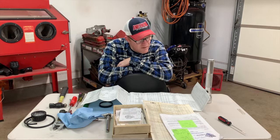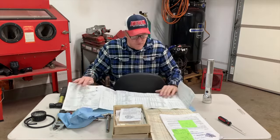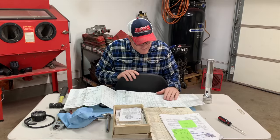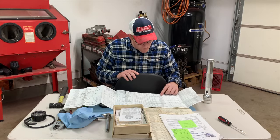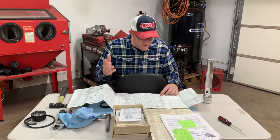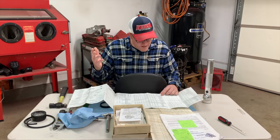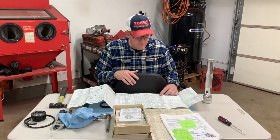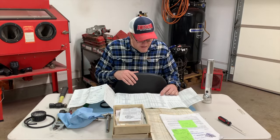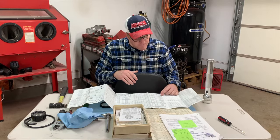So today though, since it is an electric choke, we're going to go ahead and adjust it. We're going to try to get the basic procedures. What I'm looking at here in the documentation that comes with the rebuild kits is you find the model of carburetor that you have, ours being a '78 Buick 350. It doesn't have the numbers specifically because there were so many models of carburetor at the time, they kind of just made it simple across the board. If you had a '78 or '79 Buick, it's actually a 350X engine, which, if you look at the VIN, the H, J, and X are generally the Buick from '75 to '80, which was the last production year.